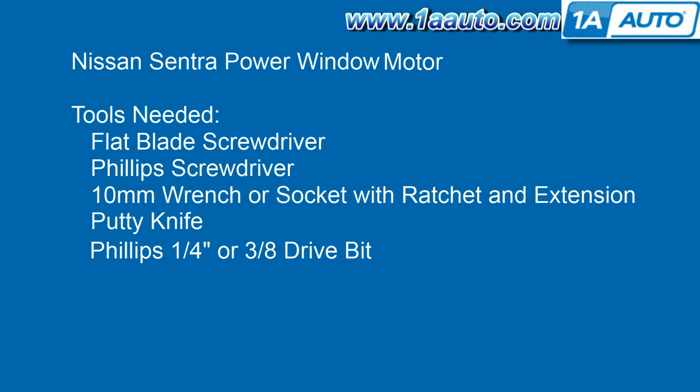Tools you'll need are a flat blade screwdriver, Phillips screwdriver, a 10mm wrench or socket with a ratchet extension. Really, the socket with ratchet extension is the easier way to go. You'll need a putty knife to help get the insulation off, and then you'll need a Phillips socket bit, which can either be a 1/4 inch drive or 3/8 inch drive, and you'll see how I use that later in the video.